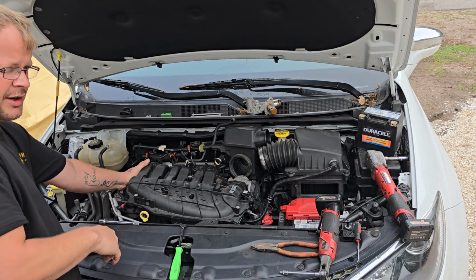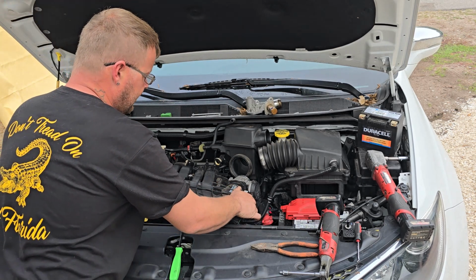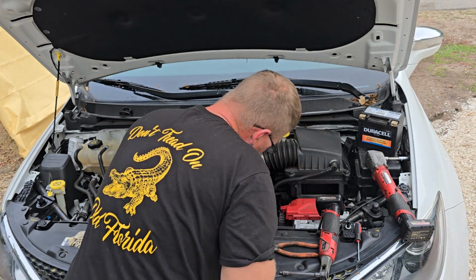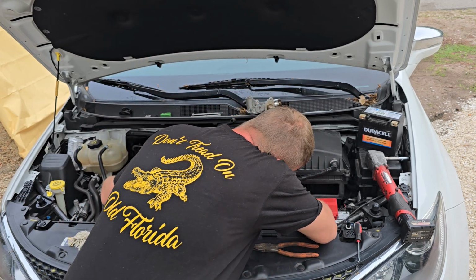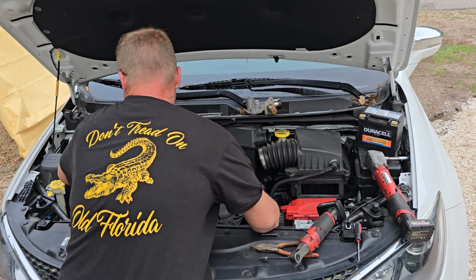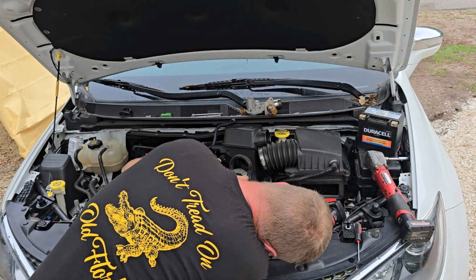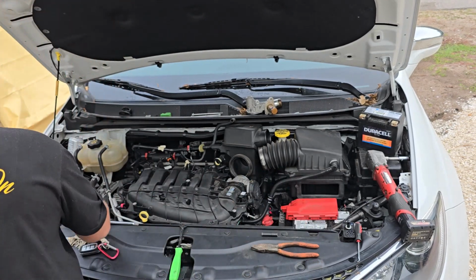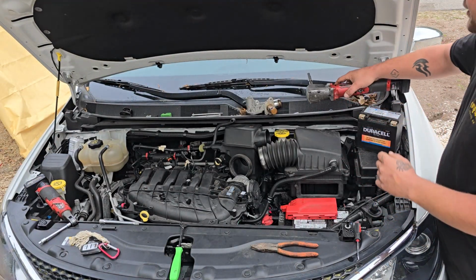What I just did there was pry that bracket in the front against the intake slightly to be able to get the lip past the two bolts that hold it on. Make sure there's another wiring harness connected down on the bottom side. The wiring harness for the throttle body is what's connected there. It has a bunch of Christmas trees all over the place. Be mindful of them when taking it off. Don't go jerking things out.